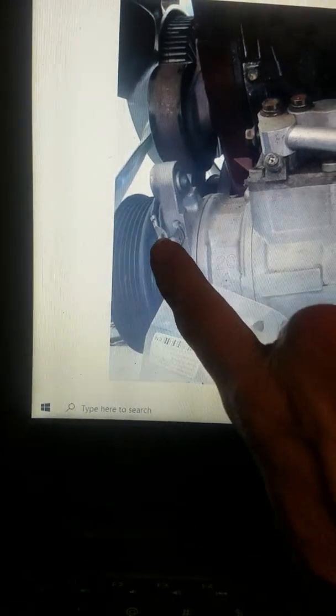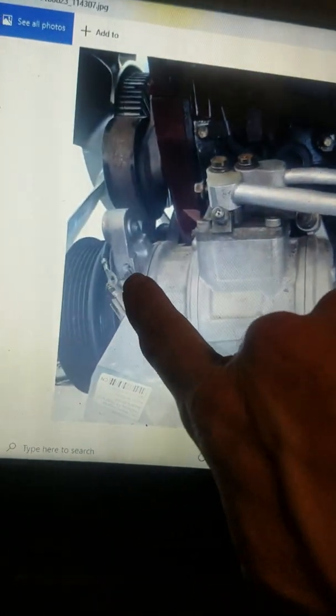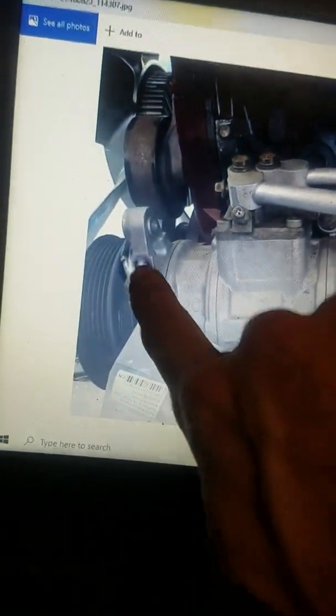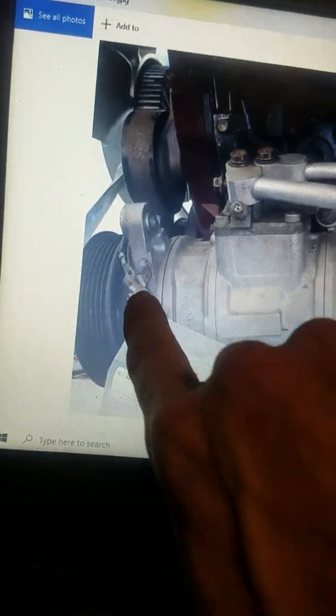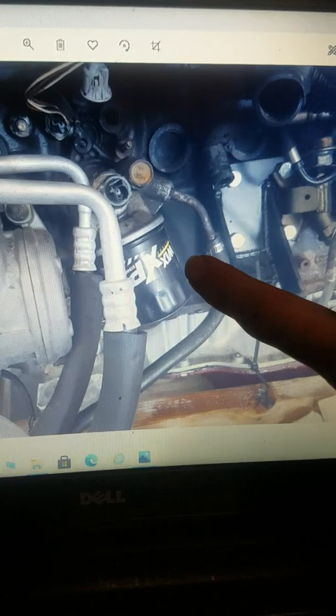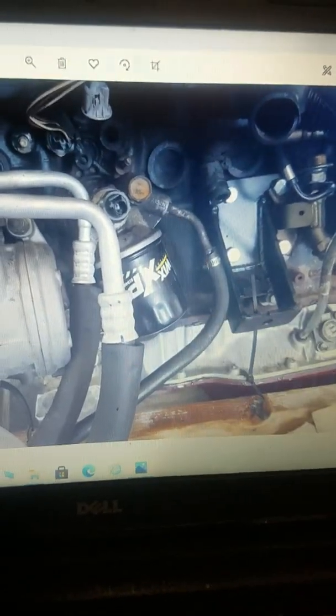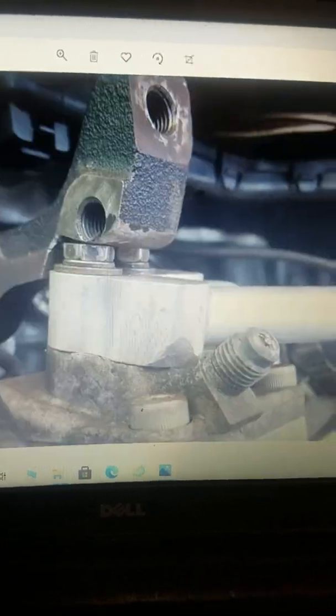I wound up grounding the compressor magnetic clutch to this screw hole right here on the JZ compressor. And I think the screws that were on the hat are the same pitch and thread, so you can use one of those screws here to ground everything and to mount your harness plug, which is what I did right there. You can see in the background I've taken off the air and oil cooler thing, and I actually put the 7M oil cooler on it. I'm going to make a video on how this is compatible and what I did. That's another story. So here we go.